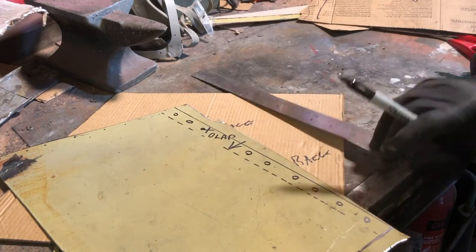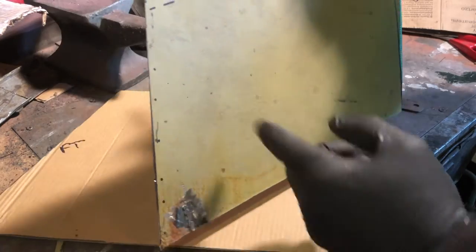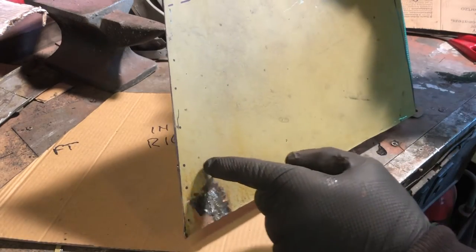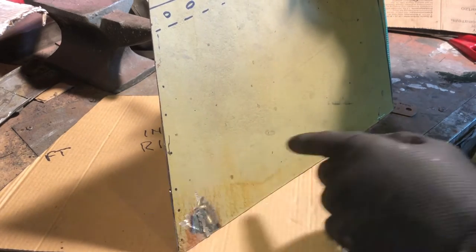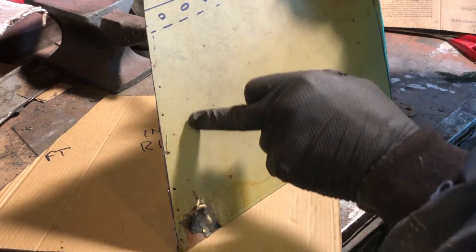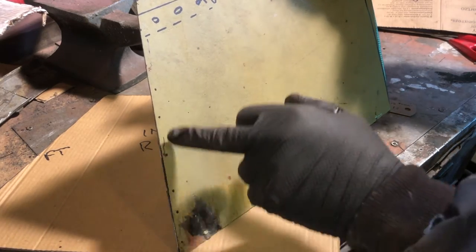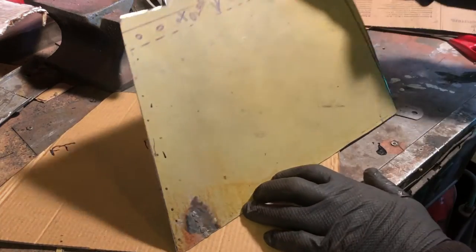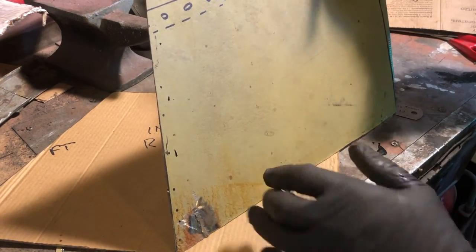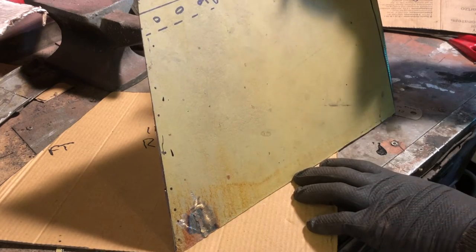everything nice. This rear edge should go right up to the bulkhead along here, and it will leave about half a centimeter between the edge of the steel and the bulkhead, but it will have about a centimeter and a half of overlap on the inside. So same sort of deal there. We'll obviously put some holes in this to rosette weld onto what's on the car. It should make it nice and strong. So we're doing one side at a time anyway.